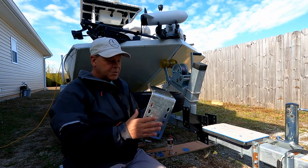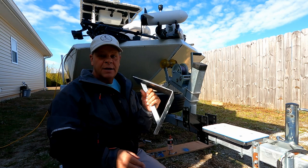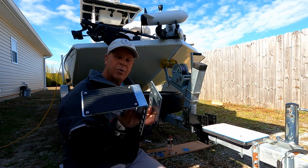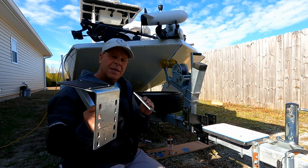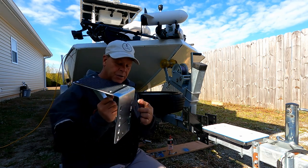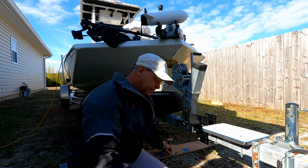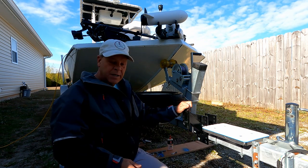For step two we're going to install this step, also available on Amazon. It's rated at around 300 pounds and will probably hold more — this is some good thick steel. Along with this bracket, if you just wanted to mount it to your trailer tongue bolt it together, you're done. We are going to use this bracket, but first we'll do a standard height install and then a raised height install. The bolts are wider so you're going to have to drill two holes on this bracket. For this you will need four one-and-a-half inch carriage bolts, lock washers, and nuts.